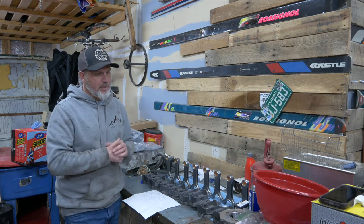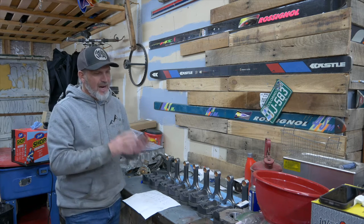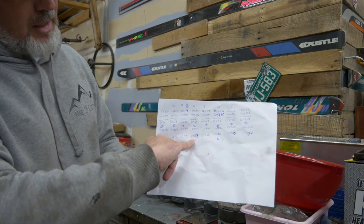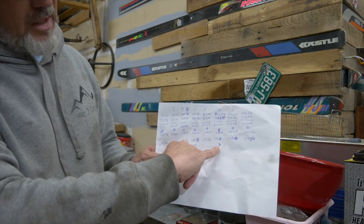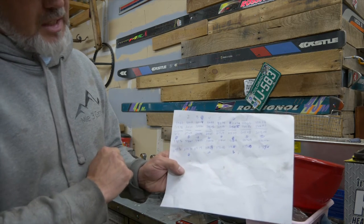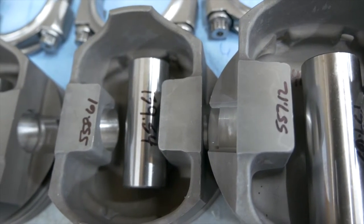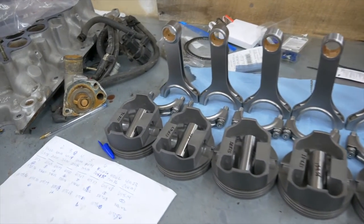When I got these pistons back from the second machine shop, I still was not happy with them. But now that I've worked on it a little bit, I feel much better — within one gram low to high. My heaviest is 1173.83 grams and my lightest is 1172.89 grams, so that's within one gram. That's everything in the rotating kit, and the rings are even across all eight cylinders, so they're not going to play a big factor. Now that the math is done, I'm going to start assembling these pistons.